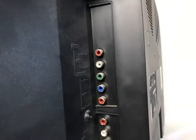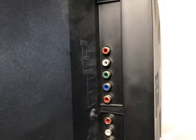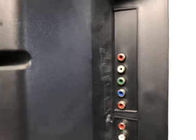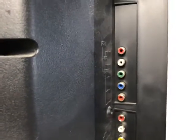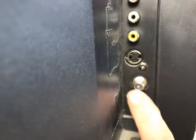On the TV — coming from a VHS — do not connect to these connections here, because these are for high definition things. You find these connections more on DVDs and things like that. This TV doesn't have an HDMI cable, so you might see that other connection. Moving down, you've got an S-video connection, which you would only see on DVDs. Then you have an RF coax connection, which VCRs do have.